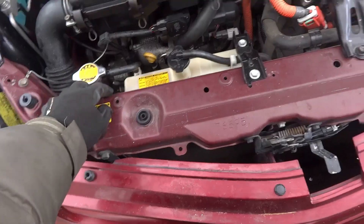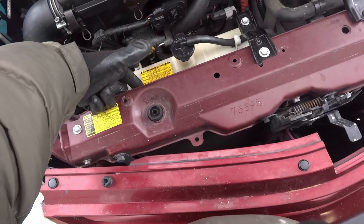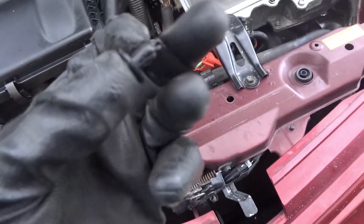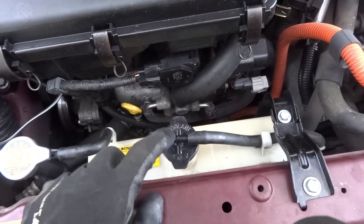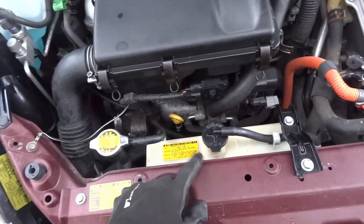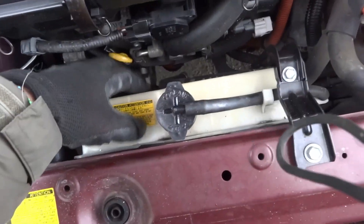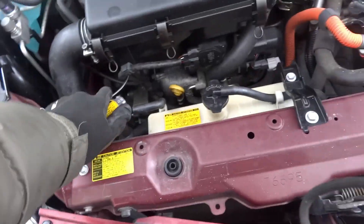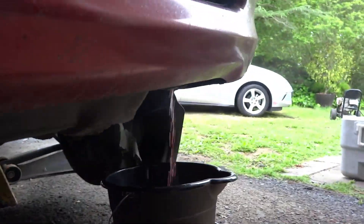Everyone struggles with the little plastic bits, but the trick is you take your hand and you push up from the bottom while you're pulling them out. They're not really screws — push up with your finger to release those tabs all around. If you are not replacing your coolant and you want to do a full drain and you want all the coolant to come out of this external tank, then if you leave this cap on it'll just suck a vacuum. Undo this and you should see the coolant flow faster.